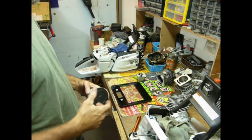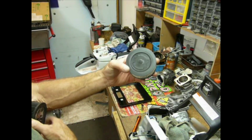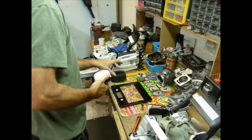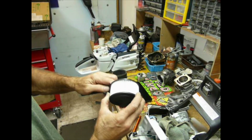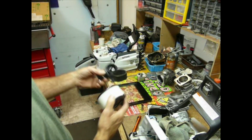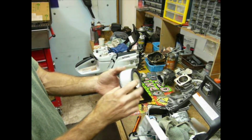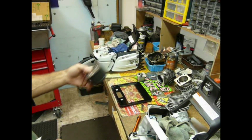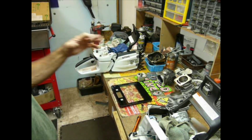So we'll talk about the air cleaners. And so the new style is a quarter twist kind of a thing. So it's got a rubber lip around here that seals on this part here that's inside basically, and they get loose pretty quick. So yeah, cartridge style though, smaller surface area I would imagine. HD2, they flow about 77 CFM, I think that is what the factory rating is for those.